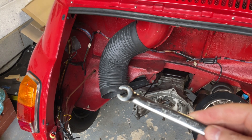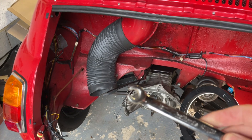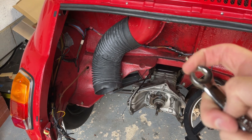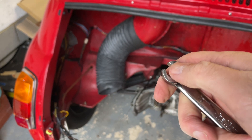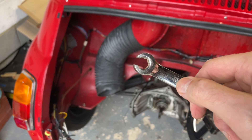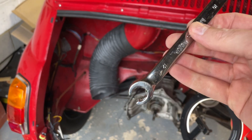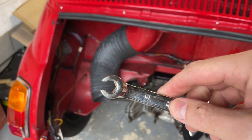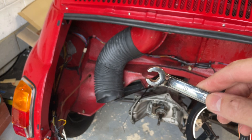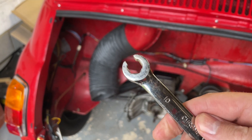The final piece: if you are doing adjustments, get yourself some proper brake spanners. They're different from ordinary spanners — kind of like an open-ended hexagonal spanner, but with just enough room on the end for the copper pipe to go through, giving you a really strong grip around the nut itself. Most are size 10 on these copper pipes; this one is dual-headed with a 12 on the side. They're invaluable — they give you the right purchase and mean you don't ruin the nuts. These happen to be Halfords Advance, but just make sure you get a good quality set.